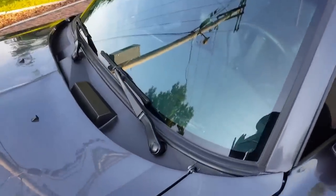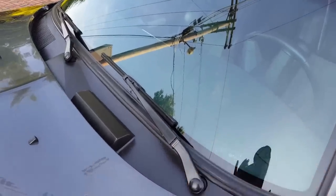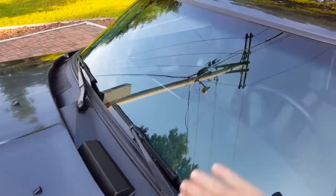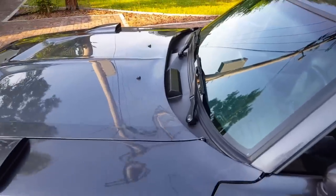There was a lot of work with the wipers also, making the mechanism so that it would go around some of the steering wheel supports and so forth, and shortening the arms so that it would have the proper sweep across this upright windshield, and repositioning the mechanism in such a way that that would also work.